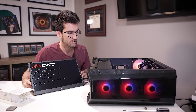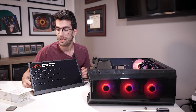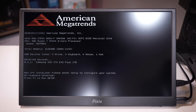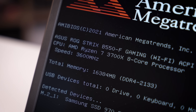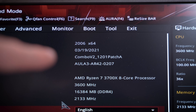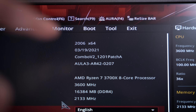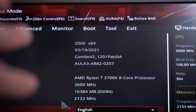The last thing I want to do here is update this BIOS if it isn't already updated to the latest revision, and try his CPU again. It's possible things just got very aggravated and a newer BIOS revision could make booting with the newer Zen 3 chip much easier. I doubt it, but I want to cover all my bases. It looks like we're on a BIOS build date from around March 2021 — that's almost two years old. I'm sure there's already baked-in Zen 3 support for this BIOS, but I want to update it anyway just to be on the safe side.